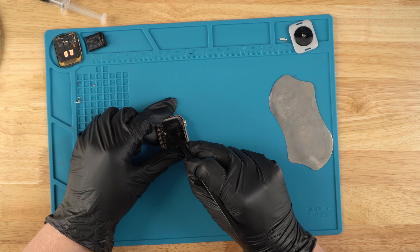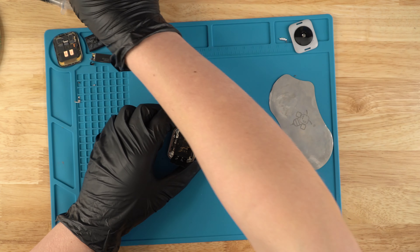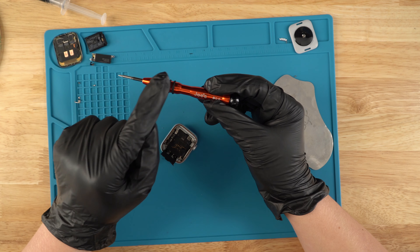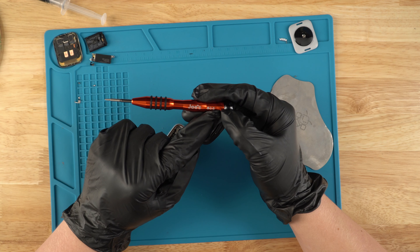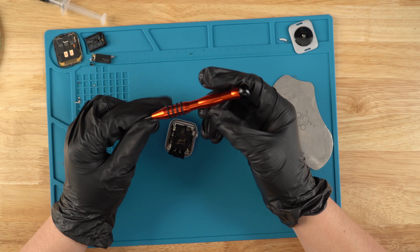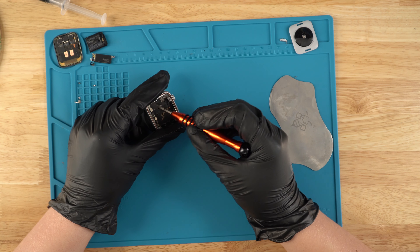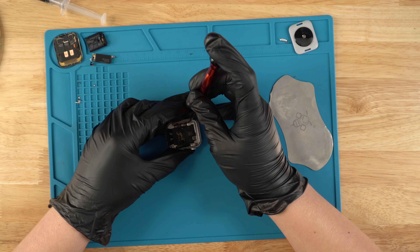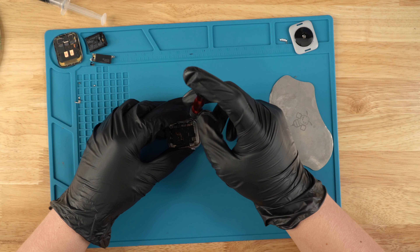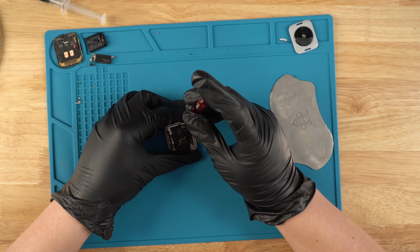Let me just lift the taptic engine up. By the way, this is the only screwdriver you'll need — there's a 0.6 Y screwdriver, which will be down in the description below, our Joe's one. We're going to remove these two screws that are holding down the whole unit — basically the motherboard back cover to the housing. We'll just remove that and put the screws aside.